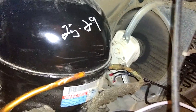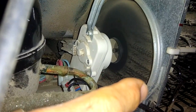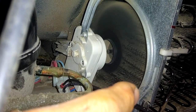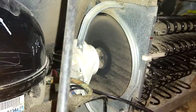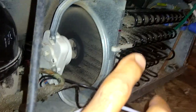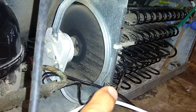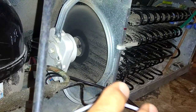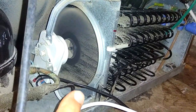Another thing you also have to switch on is the fan for the cooling coils. Normally, if you had an inexpensive entry-level refrigerator, it might have a set of coils along the back, and there wouldn't be any fan. But on these mid to upper end refrigerators, they make these coils a little bit more compact, and they stuff them underneath the refrigerator, which makes their ability to get cooled from just the ambient air next to impossible. So they have to add a fan.